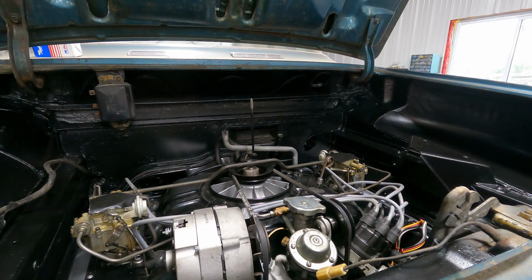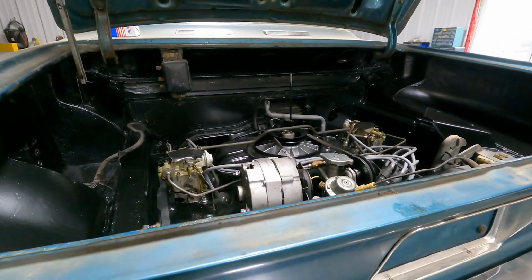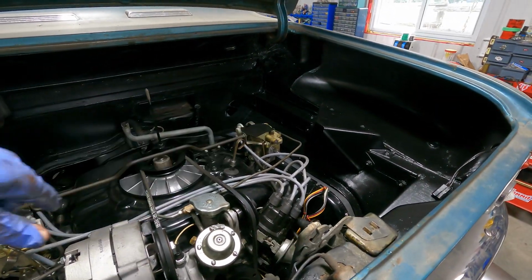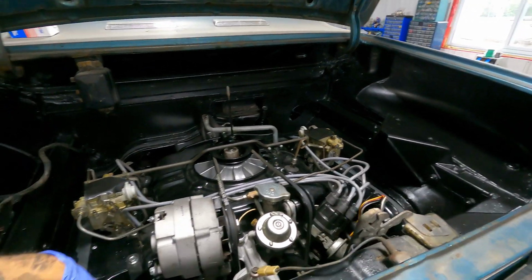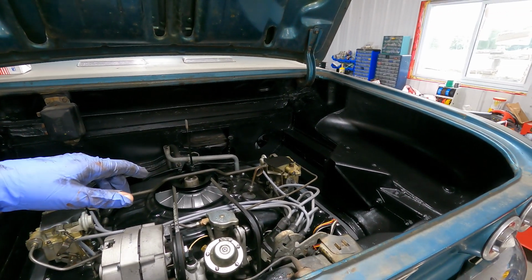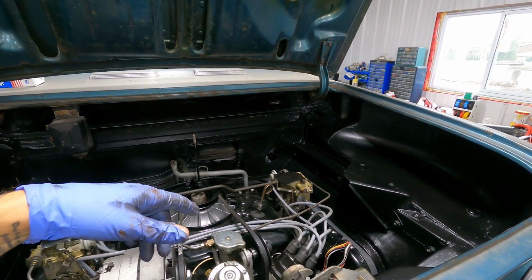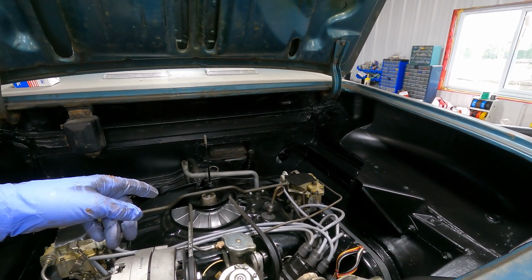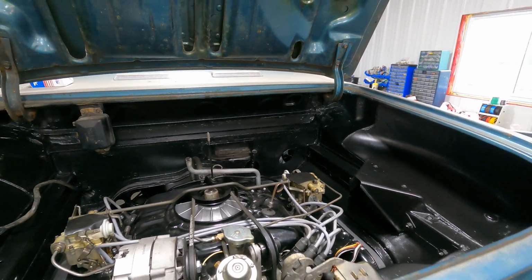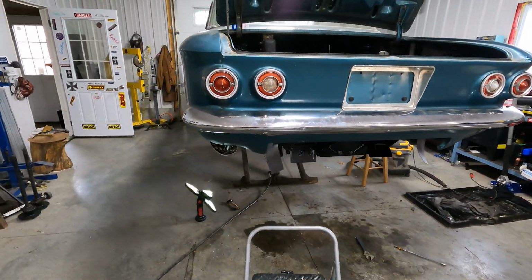Okay, it looks impressive that it's in here, but that was really only 3 bolts. The real work starts at this point. I've got to flip that perimeter seal up and then put the retainers all the way around both sides and the back, put in the cotter pins for the castellated nuts for the engine mounts, and dipsticks. It's a 64, so it has a dipstick for the trans and a dipstick for the diff. 64s are my favorite for a lot of reasons, and that's one of them. 65s have that too, but I do like a 64.